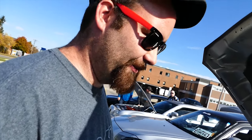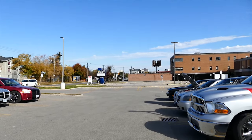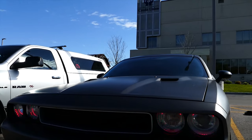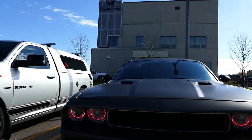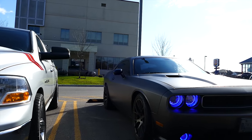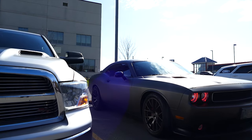A lot of people do this stuff and they don't tune it. I don't get it. You gotta. The problem is, I went so far with this thing — once it was back together, this was a several-month process. You'd fire it up, and because it was high idle on cold start, as soon as it came off high idle, it would die. It would quit. It wouldn't run anymore. That was before the tune. Like, you couldn't even drive this thing how we modded it.